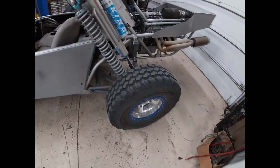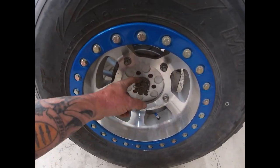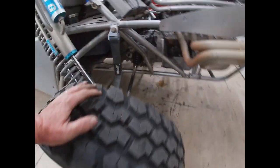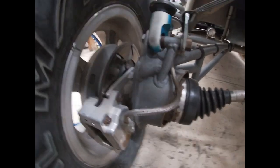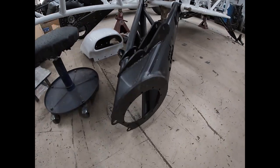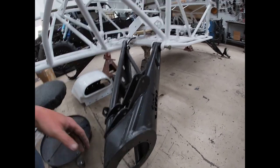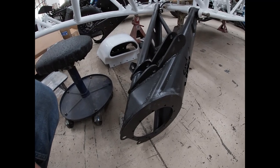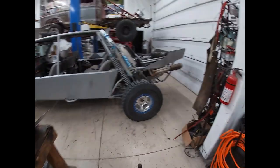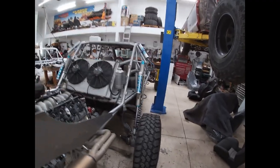I have some plans for this motor - I'm either going to put nitrous or a turbo on it, probably turbo-charge it eventually. I've got a set of 930 midboard hubs. Basically a standard hub has a big nine-inch stub axle, kind of like VW style, and the CV bolts right up to that stub axle with an aluminum bearing carrier in the middle. A midboard hub is different - it's got a giant hub, the CV actually sits inside the hub, and it uses really big bearings that don't go bad very often.